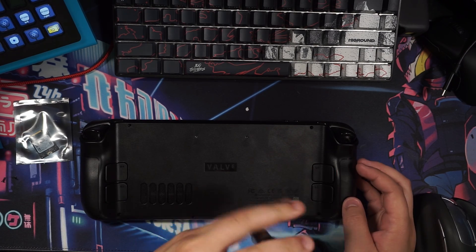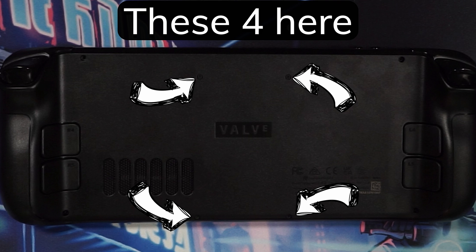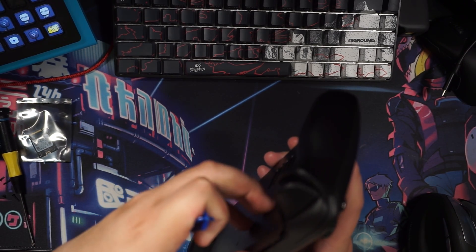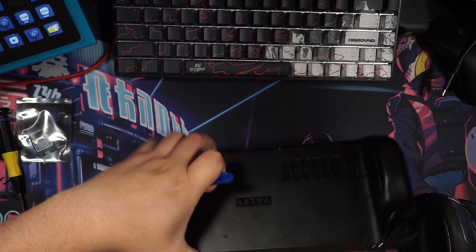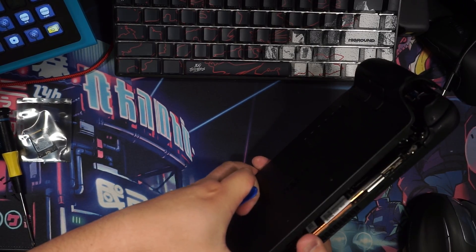Do note the size of the screws — 4 of these screws are smaller and go back into the inner center screw holes. Next, with your plastic pry tool, you need to basically wedge and pry off the back panel. Take it slow by starting near the triggers and prying a little at it. There are clips holding it in place, but beware that there are also ribbon cables, so take it slow so you won't rip said ribbon cables.